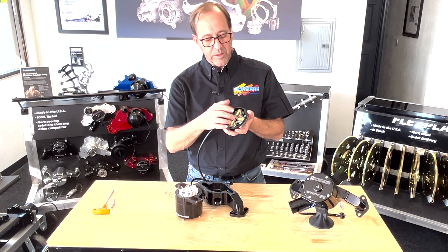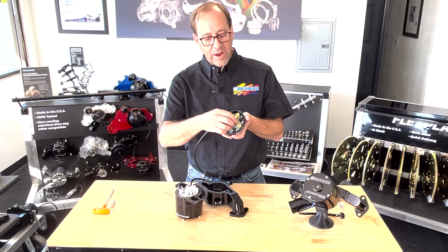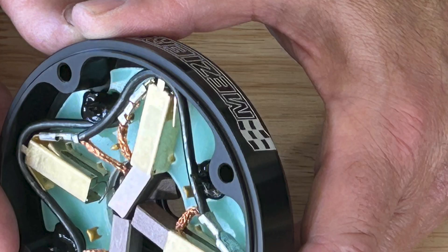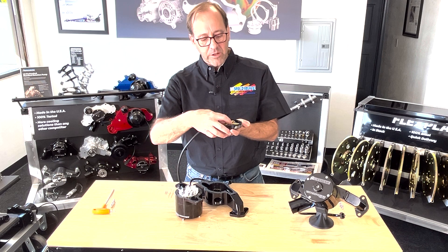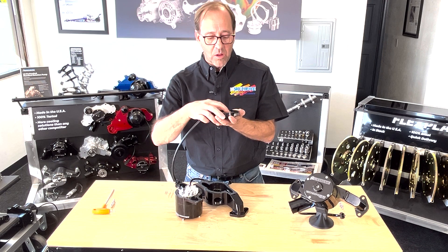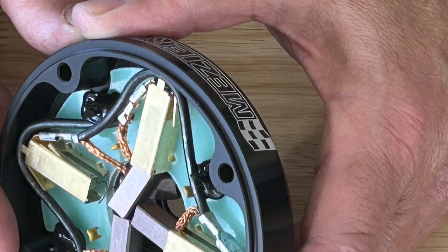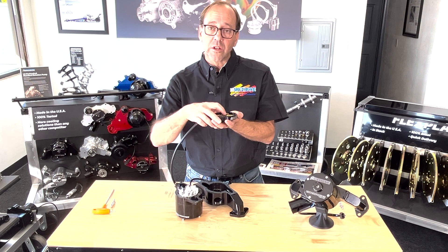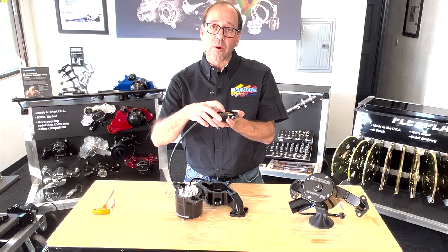The brush can only really align one way. The wire connecting to the brush has a slot that creates clearance for it. Right at the front of the channel there's a very small through hole — that's the key to our success. We're going to show you how to retain these brushes using some straightened-out paper clips.